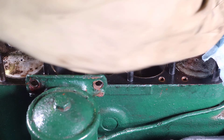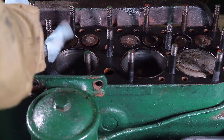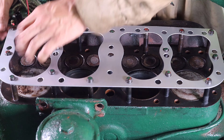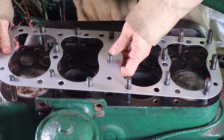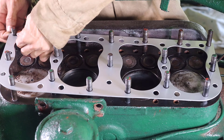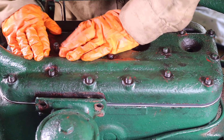As mentioned previously, the cylinder head studs were chased. Like the removal process, this will also help to reinstall the new head gasket and later reinstall the cylinder head. The cylinder head gasket dropped right into place — it looked good especially with most of the carbon and some of those holes cleaned. The cylinder head also dropped in very easily over the clean threads.